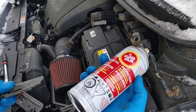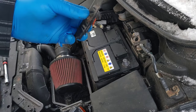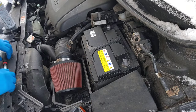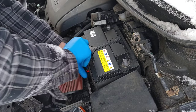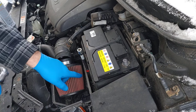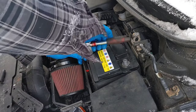If you have this kind of product at home, you can apply some anti-corrosion on the screws. Now put the bracket in place, put back your 13mm socket, and start tightening it by hand if you're able. Once the screw is started, tighten it with your ratchet.